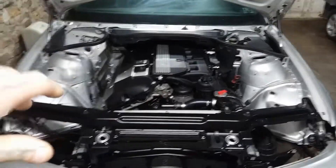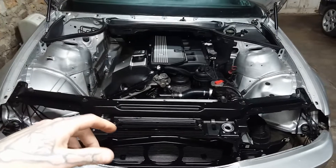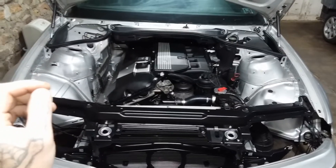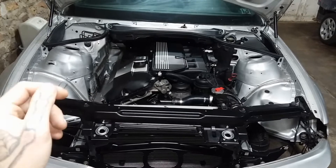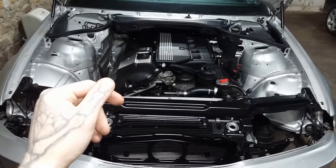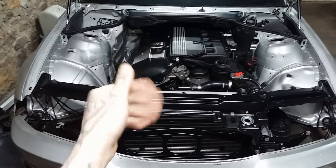Here's the engine bay. A quick recap — we're running a 2.8 liter bottom end, as I prefer that bottom end for its high revving harmonics. The 2.8 liter displacement stroke nearly matches the bore, making it a very well-balanced revving engine. The 3.0 liter is good for power, but we do suffer harmonic issues in the high rev range. So 2.8 liter it is.